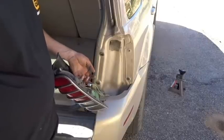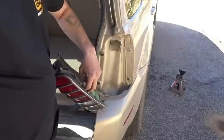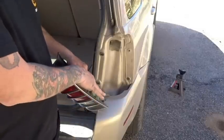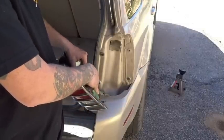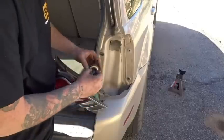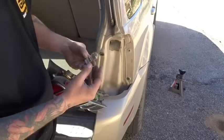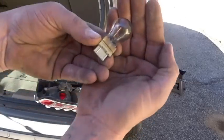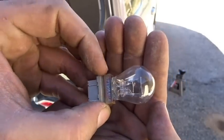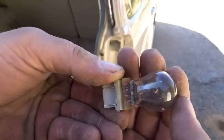I've already got a problem here. A U-Haul trailer wiring harness has been spliced into our wiring harness, so I'm hoping that's not going to play a role. The electrical connector I tried to simply push and pull on just broke. So without trying to further damage it, I'm going to rotate the bulb counterclockwise until it frees itself and pull it out. You can see where it's smoked — right here. It looks like it's been changed before because that's an aftermarket bulb. My thought is this bulb is simply burnt out.